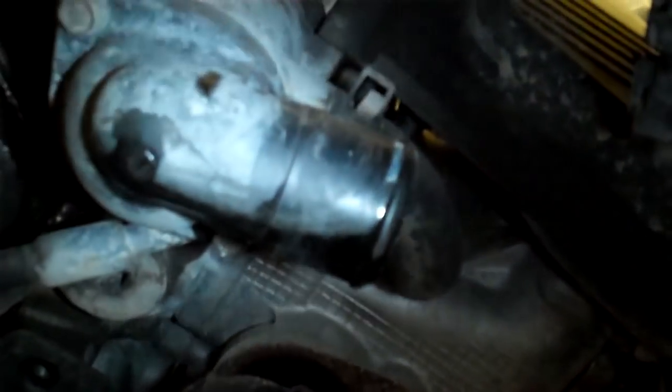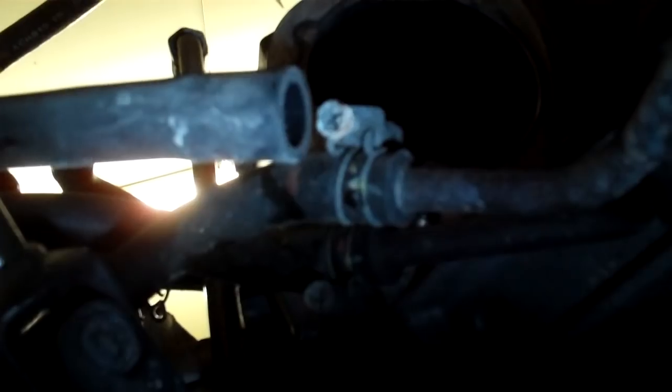So underneath you've got your lower radiator hose, which we would have pulled already when we pulled the radiator up and out. Oil drain, we already did that. Same thing over here. And then you want to swing over with the same socket and pull the nuts off of the motor mount. There's one on this side, and there's another on this side. So you want to have those pulled, and then you want to creep underneath the driver's side and get that 17mm nut off the stud for the starter, and also the electrical connections, the signal wire for the starter, and then the power supply, the positive cable.